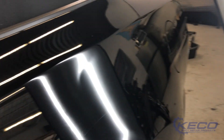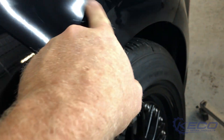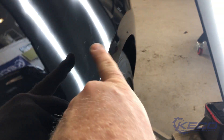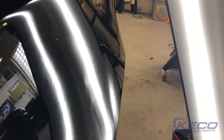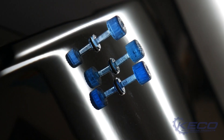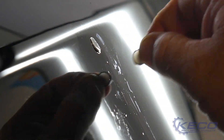Here is where we got to through a couple rounds of pulling. I'm pretty certain that we are fighting a sheet of sound deadener up there — I can't even get a tool in there either. The crease down here is moving really, really well, and across the panel we've made drastic improvements. Getting dialed in here, you can see I've got a couple high spots — I'm going to leave those in while I continue to pull, as that's going to help the metal just move around a little bit. And here I want to show you some quick action working towards the top of the quarter with some small dead center tabs, just trying to clean up some of those micro lows.